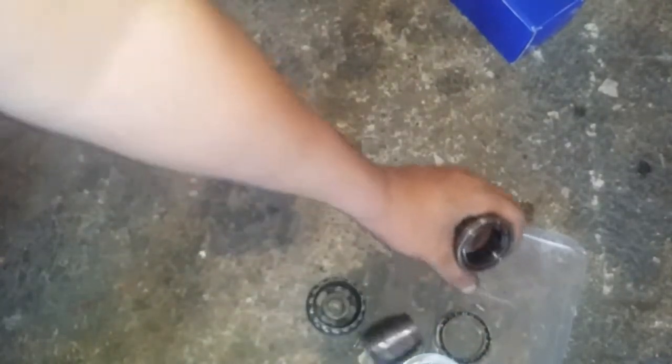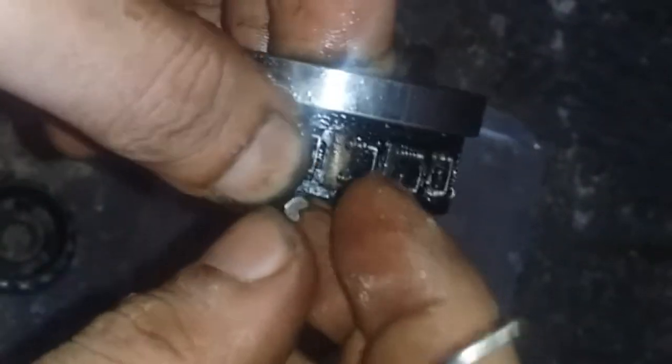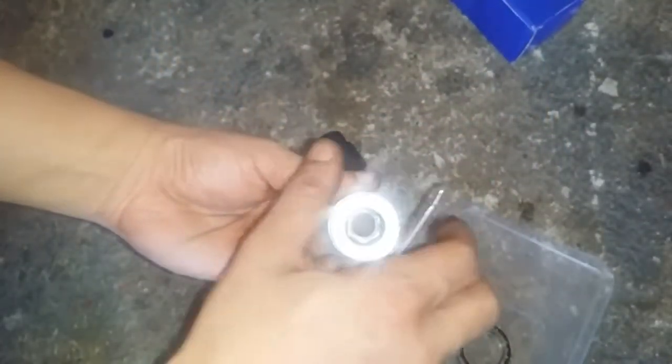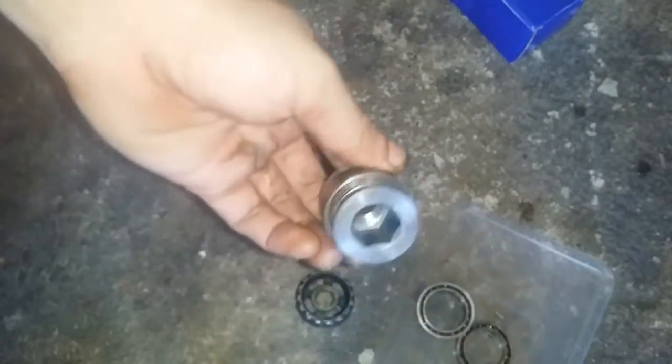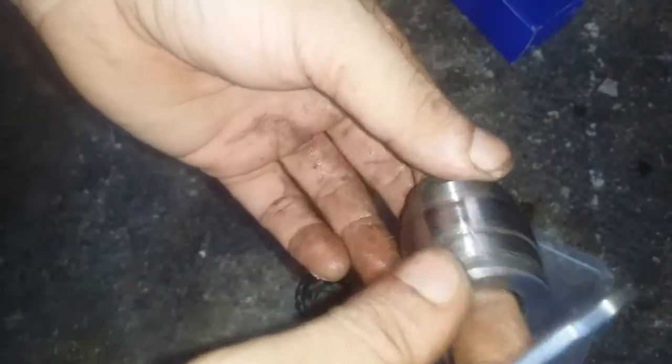I tried several ways possible. The orientation was like so, and then I tried reversing this — putting in the bearings backwards. At one point I thought I was able to get it to work: to lock when you turn it clockwise and to freewheel when you turn it counterclockwise. But when I installed it on the alternator and back on the engine, it would still slip.